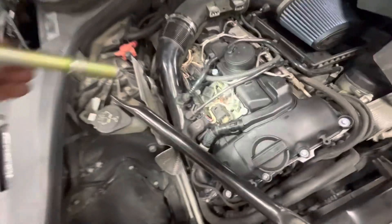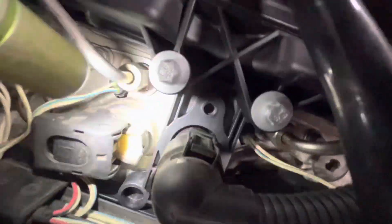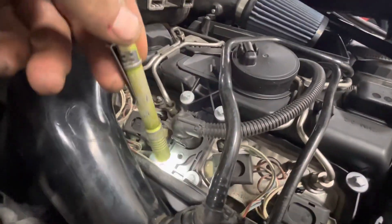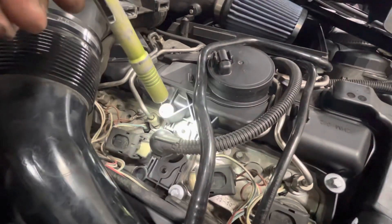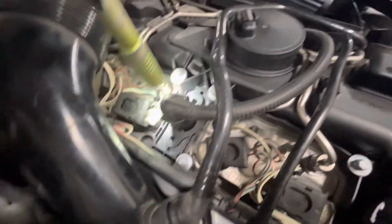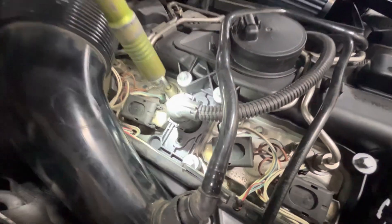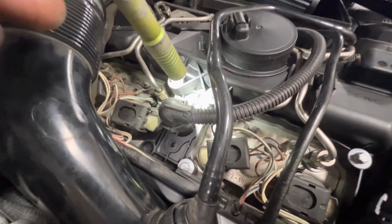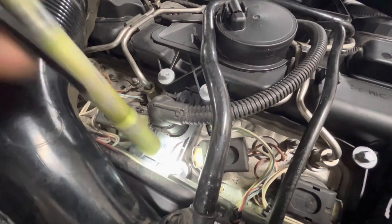What happened here is it has a bunch of mixture-related faults. As you can see right here around this eccentric shaft sensor and the actuator — this is the whole assembly where it comes through — this is just the plug where it pops through the valve cover. There's supposed to be a gasket here. The new valve covers don't come with that gasket, but you have to order a new one and install it. They screw in with these coarse-threaded screws.